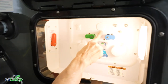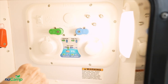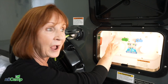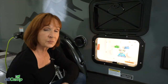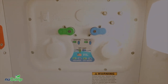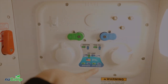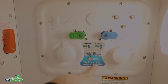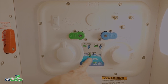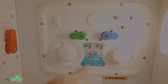In the center you will see a tank flush, which simply has a cap over it because there is no black tank — only the cassette toilet, so you don't need a tank flush. On the left is the water pump switch if you want to pump water out of your fresh water tank. In the center of this panel are the green and blue levers — those are set according to what you would like your Nautilus panel to do. If you're using the city water on the right, you'll want them in one position. If you're dry camping, match that picture. To fill the fresh water tank, set them this way. To sanitize or winterize, just follow the pictures.